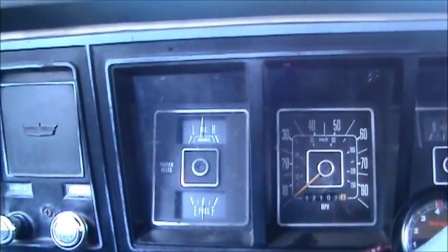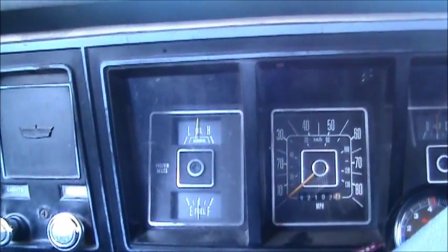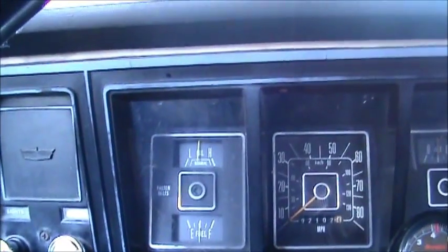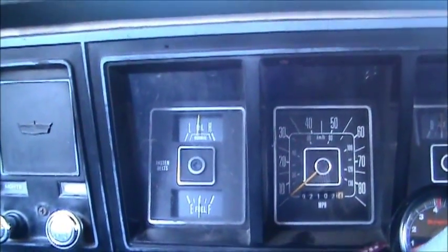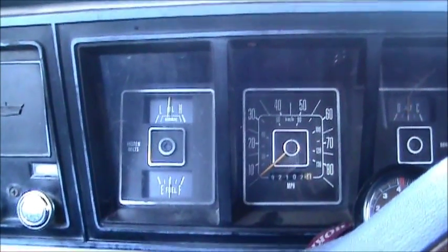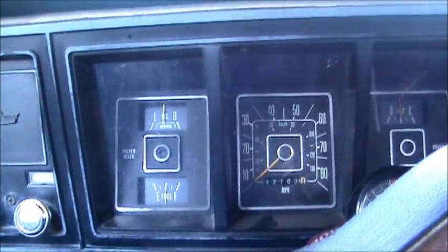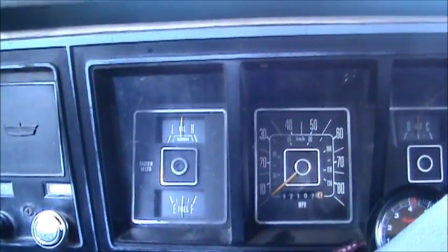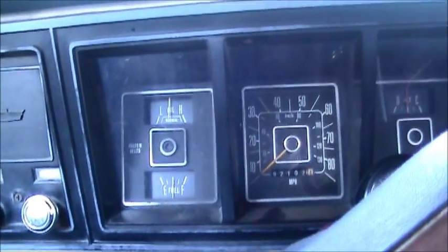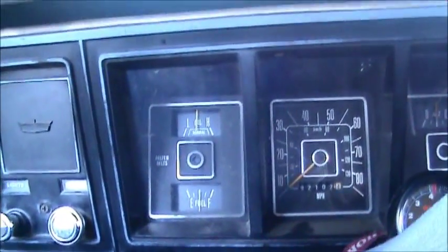I think it's got the sender for an idiot light in it — that's what I really think it is. It's just kind of on and off, that's what it seems to me. So basically it's running high oil pressure, and as it's cold and it warms up it's running lower, but enough to change the reading. Because the idiot light's an on-off switch and this is a variable voltage, so it could do anything crazy. But it's got absolutely fantastic oil pressure.